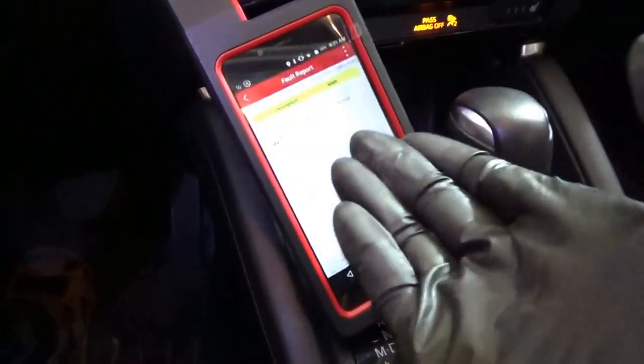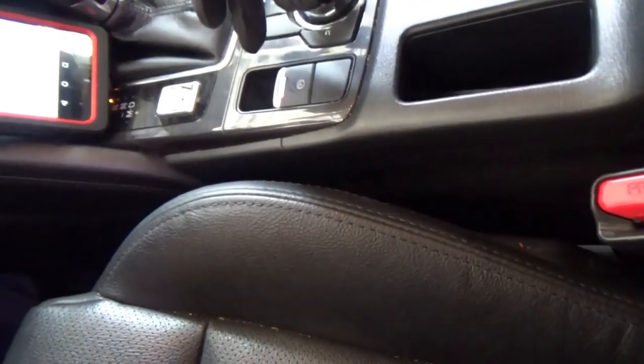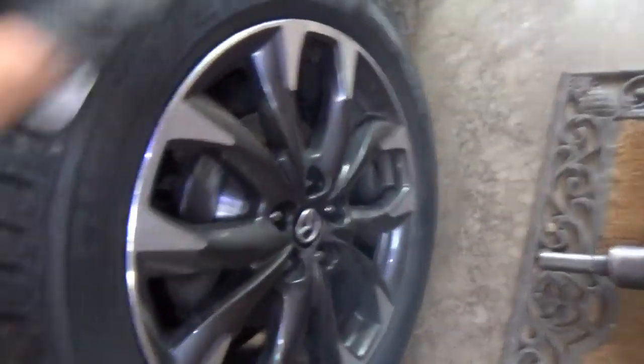To reset the system it seems like you turn that little spindle backwards almost as far as it'll go, and then it should automatically engage and then disengage a set number of turns. I think that's the way it works. It shouldn't be this complicated. Alright, we're back in business — no DTCs. You pull up on the lever, sounds good, this wheel blocked. This wheel also blocked. Step on the brake, disengage — seems happy. Both wheels are good.